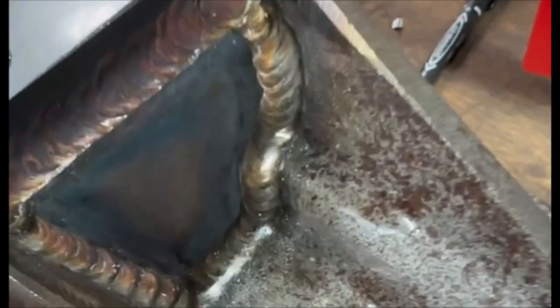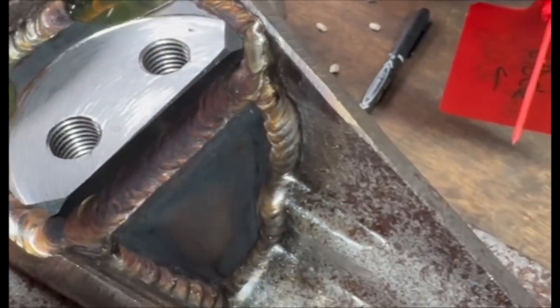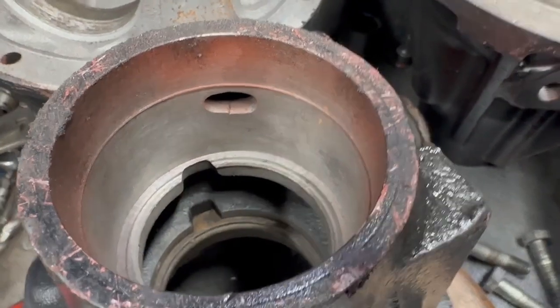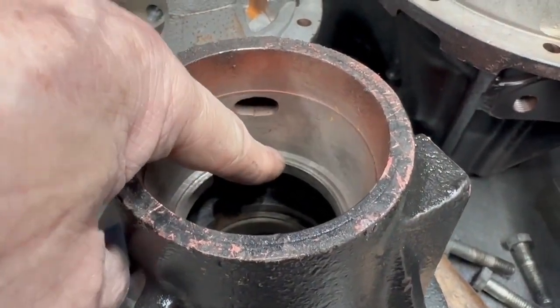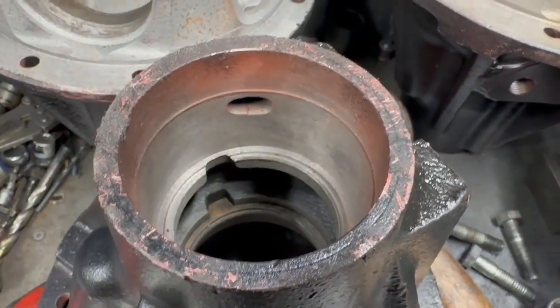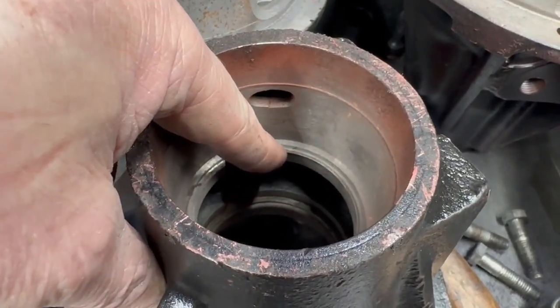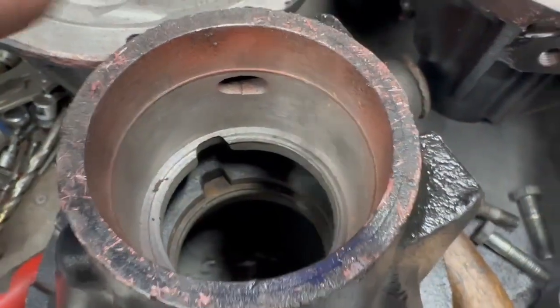We take it up, peg it, drill it, tap it, face it off, backfill it — all ready for building. You probably can't see it, but this top bit here has been bored out to take the bigger bearing. It's deeper, bigger, wider, and massive. We'll show you later in the video. Interestingly, when this was first done, the tail bearing and head bearing are lined up down there.